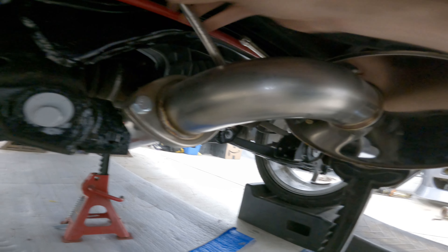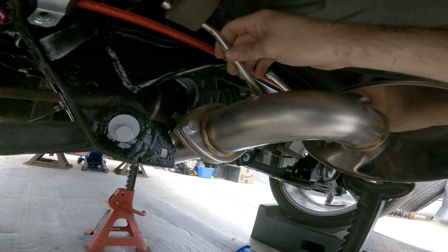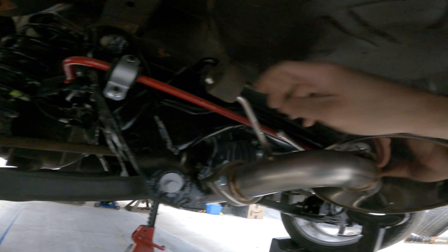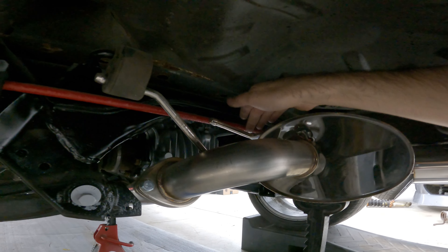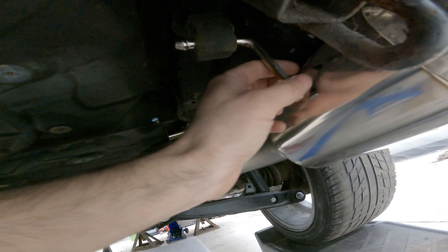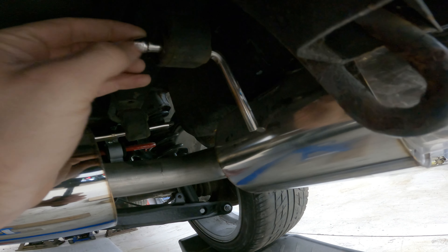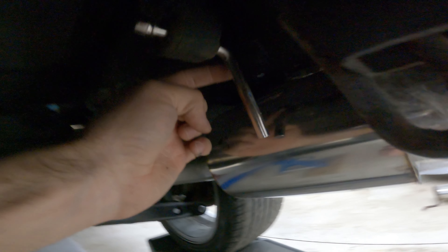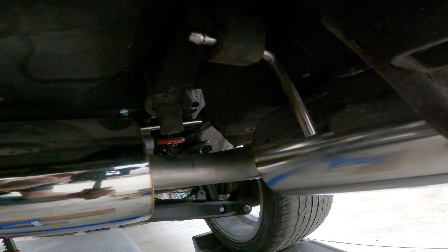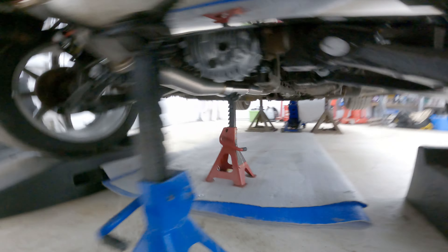This hanger is actually from the front piece. I cut two off of the mid pipe and I'm basically just going to lay them in the factory rubbers. This one's super long, so I'm going to re-tack it, weld it right there. There's one on top in the back that goes to nothing, so NA's must have a different spot there. Same with up here — I had to cut it; it was off the top and it wouldn't line up at all. Now I can just put that right where it needs to be and tack it.